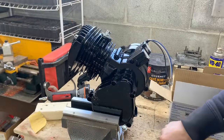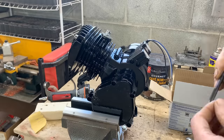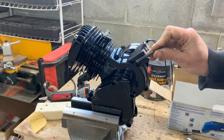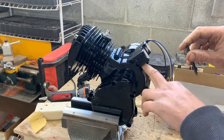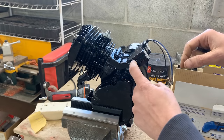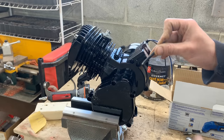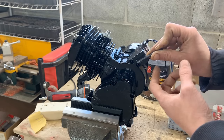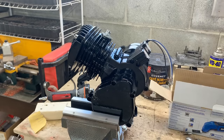All right, so it's the day after, and I got myself a 1/4 inch 20 TPI tap, and I'm just thinking here how deep we should go. We have to go as deep as possible, but of course we don't want to go into the crankcase. Judging on the fact that there are two bolts here, I'm pretty sure that this is not hollow. We can go all the way to there, I believe, because the beginning of the tap doesn't make threads actually, so we're gonna have fully formed threads only for about 1 inch, but that's perfectly fine.